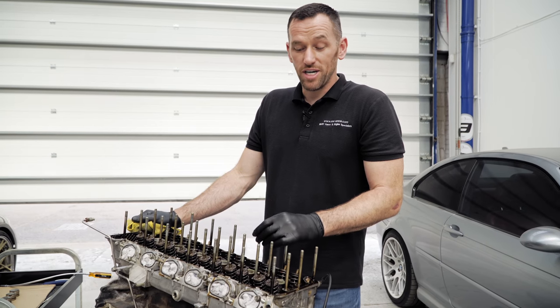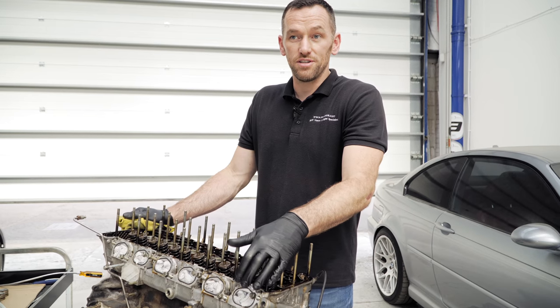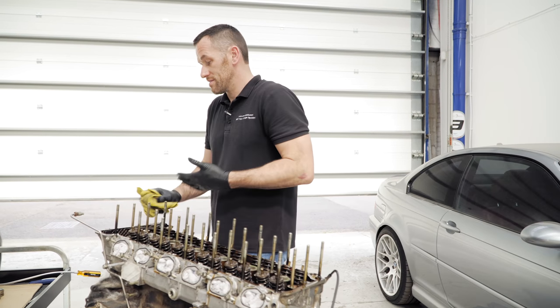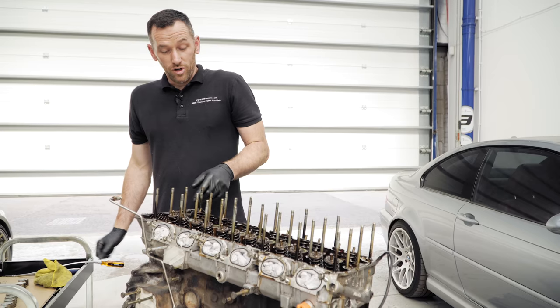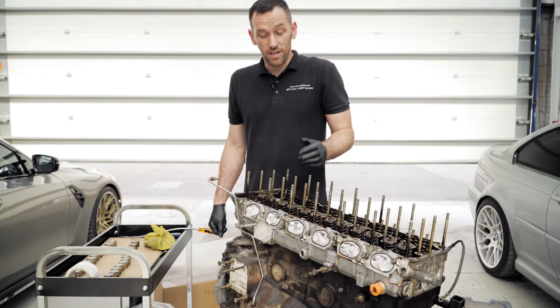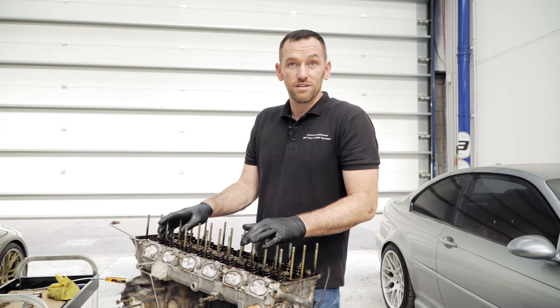As a rule, if you don't mess around with the set screws, unless you're running a tuned engine, generally speaking, it's minimal. I just want to give them a clean out. I'm not too worried about stripping them down. They all actuate fine. I just want to clean them down and re-oil them. We generally put them through a hot wash, and that's pretty much all we do. It gets all the carbon off the back of the flaps and cleans everything out. But generally, because it's not a direct injection engine, they're not that dirty.